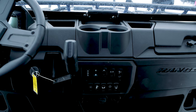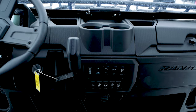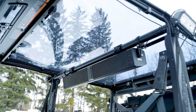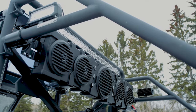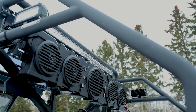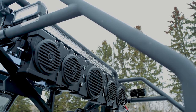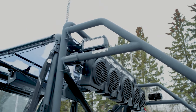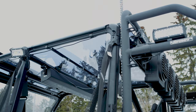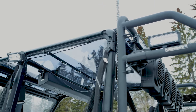On the inside, along with the lower rock lights, we've also installed four in the roof with the smoked acrylic roof. On this unit, we installed two sound bars — a 28-inch on the interior and a 42-inch on the back. That one is wired directly to a secondary battery. So if you're out at the lake or wherever you happen to be, you can bump through tunes all night long. We've isolated the batteries so you can kill the battery that runs the sound bar and still be able to start this thing and drive it home at the end of the day.